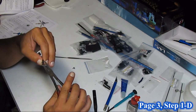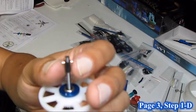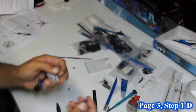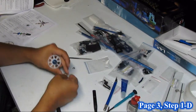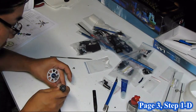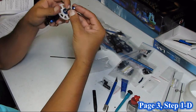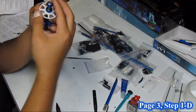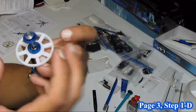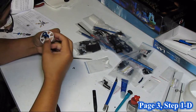The trick is getting that pin lined up and going in. Sometimes it helps to rotate it around the other direction. For this I use a pair of smooth-jawed pliers because you don't want to mar up the pin too much or make it hard to go in. You want to get it centered on the shaft because it's going to ride inside the lower one-way housing. Usually this lower bearing just kind of drops into place — it doesn't actually press fit in there. Make sure that it spins freely without any rubbing noises, and pull everything up so the holes are all lined up.